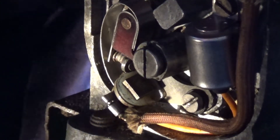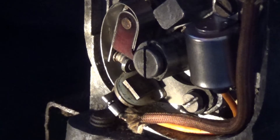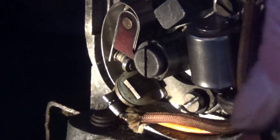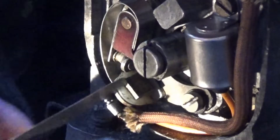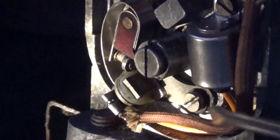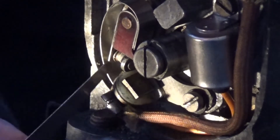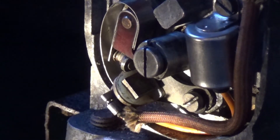I've managed it with the greatest of difficulty. I've had to take the points off and I've cleaned them up - actually in the light, filing them. So I'm just gapping them again and I'll put it at the same because they were at 10 thou, and we'll see if we can get them back to there. The gap on them should be 10 to 12 thou, it says in the book. The reason I didn't want to disturb them was because I found out why it doesn't run very well. There we are - that's just as they were.